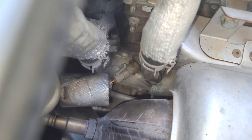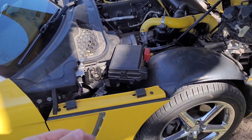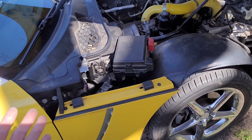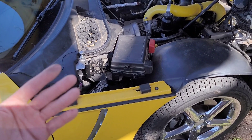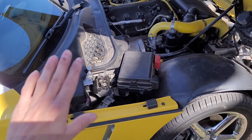When it comes to removing the coolant sensor, we don't have to do a complete drain — it only calls for a partial drain, whether that's the engine block or the radiator; it doesn't specify. But more than likely it's probably been a while since your last coolant change, so we're going to go ahead and show you how to do a complete drain block, and then we'll show you how to refill that and replace the thermostat.